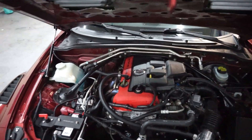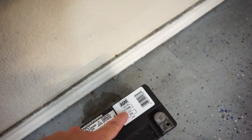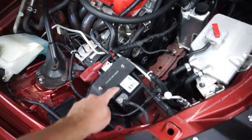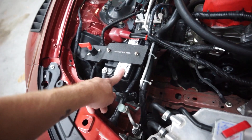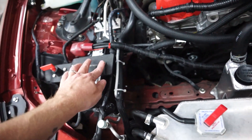So I had to replace it, and I kind of ordered the battery in a quick manner. I ordered the same brand, but we're going to try something a little different because I accidentally ordered the wrong size. We ended up going with the AGM ETX14. The old battery is the ETX20L — the 310 cold cranking amps. This new battery is only 220 cold cranking amps, so that's 90 fewer CCA. This new battery is also smaller and more lightweight, and it was so small that I had to get a little riser to raise it up to where I can tighten it all down.